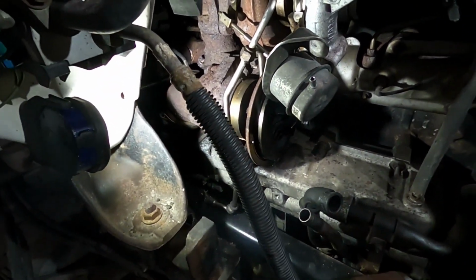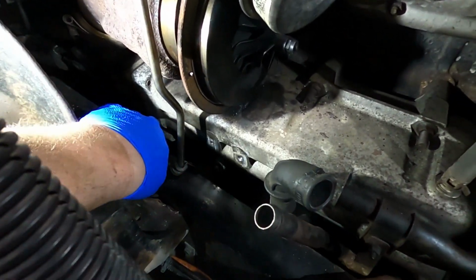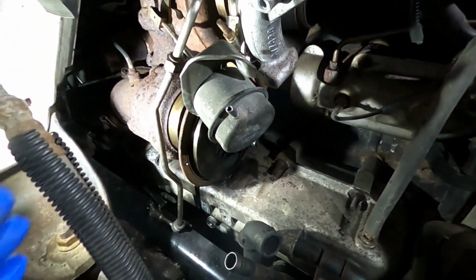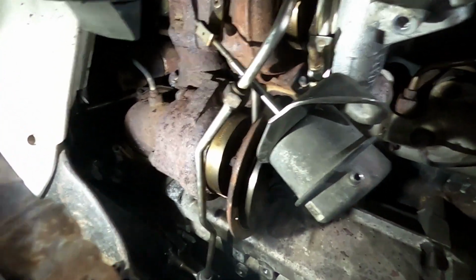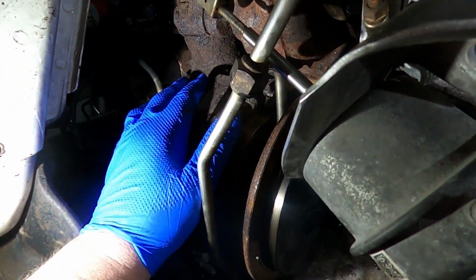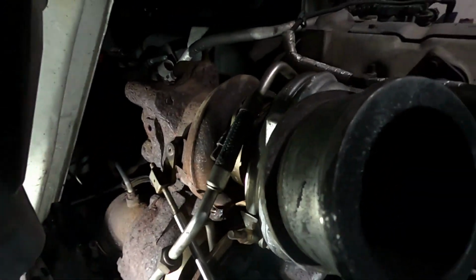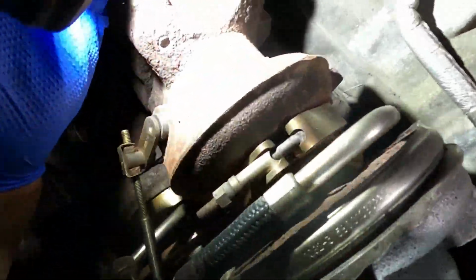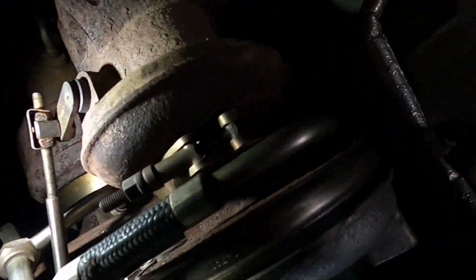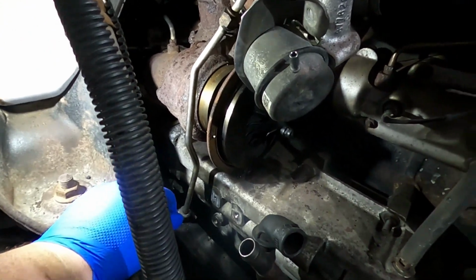I tried stuff on it. I didn't want it to break in there, so I went down at the bottom to try to spin it, and that was just kinking up, so I just cut it so I can take the whole assembly off. Already heated all the bolts to get off. Like I said, there's like 4 you can see, then there's one just right up there. Those weren't horrible, I just wanted to heat them nice and red, and not break those off.